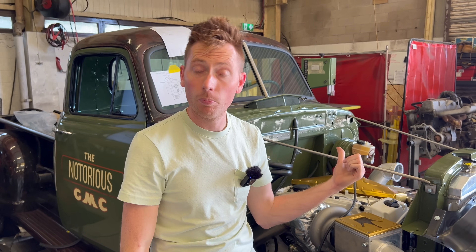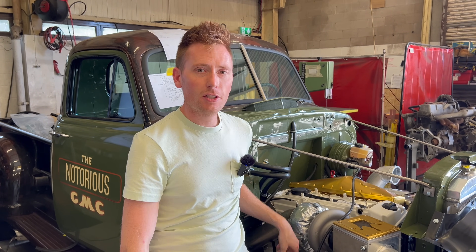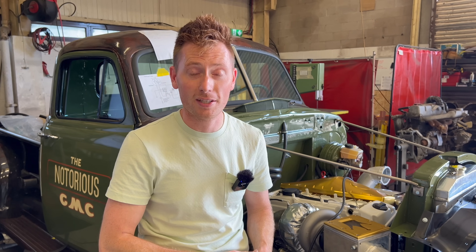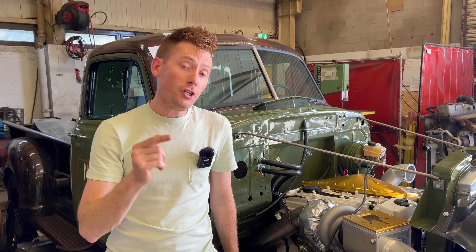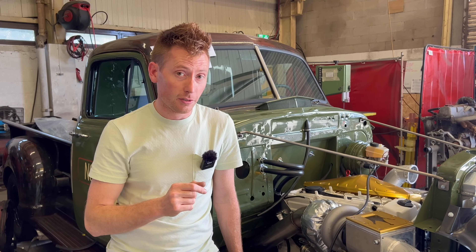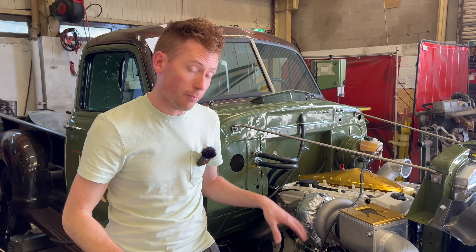Control methods for the test: 8.5 mil pump set, 150cc max, the wastegate is capped. You do need a wastegate on things that are smaller than S300s, so don't think that you don't need a wastegate on your turbo — because you really do. First test: turbo only, no quick spool valve connected, so the quick spool valve vane is open so it can aid the turbo to spool up.